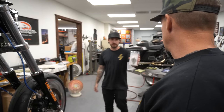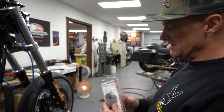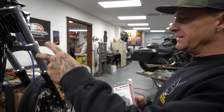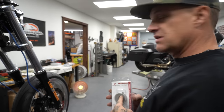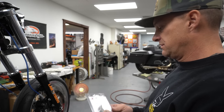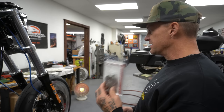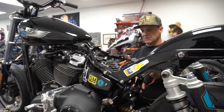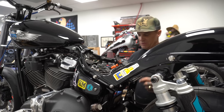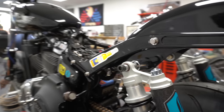That thing's bright! If you have a heavy clutch, the Mueller Easy Pull — this is a different ball-and-ramp system. The ball-and-ramp angle is different and this will take 40% of the effort out. Paired with an Elite Moto Tech lever and a 30-over clutch spring, you can one-finger that thing. I'm going to put this one in the twin cam softail build we're doing because that clutch is brutal and I hate pulling on a heavy clutch. If you can't find it on our website, call the shop and talk to Trant — we can get them out to you fast. It's the only easy pull that works — don't use any others. You want to have a complete ball-and-ramp system.